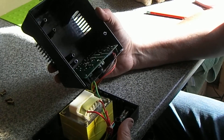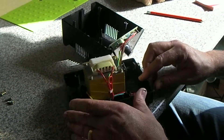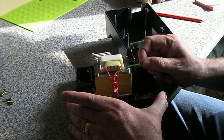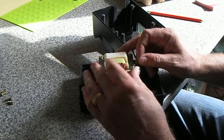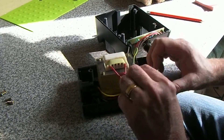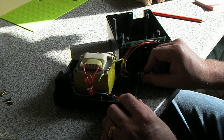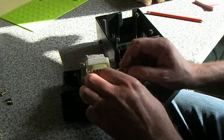Just a very simple circuit board, not a hell of a lot going on in there. But my favorite bleat about any piece of equipment that needs to be earthed — totally loose earth connections. It's taken nothing to loosen these off. One goes to the IEC socket and the other one goes straight to the IEC socket here. I just hate seeing this sort of thing. There's just no excuse for it.